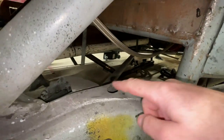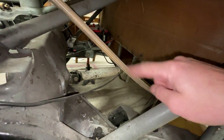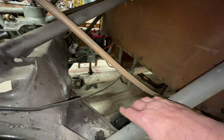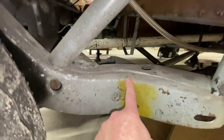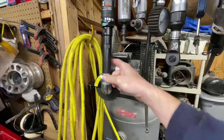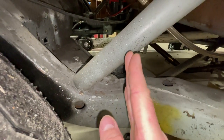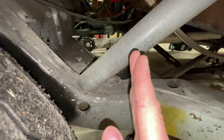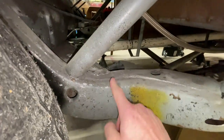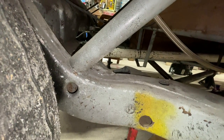because I'll measure the chassis crossways and side to side. And we'll see if this thing actually measures out properly. And if these lower mounts actually measure out, then I'll figure out a way to use a right angle square or something, and cut here and cut straight across, probably using this thing here that I just bought from Harbor Freight. Just cut one line straight there and then use a Sawzall and that cut as a guide and just go straight through it. Do the same on the other side and then cut the new chassis exactly the same way. And then it should be pretty equal. And then we'll measure it out and then weld it together and plate it and everything.